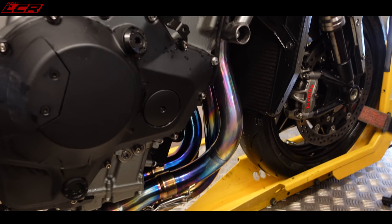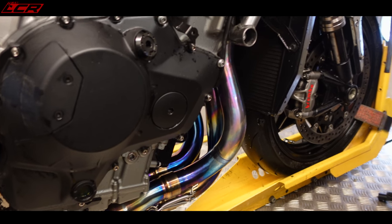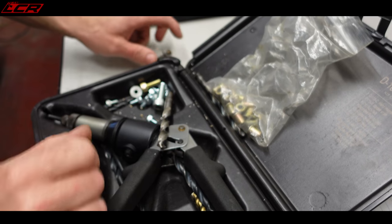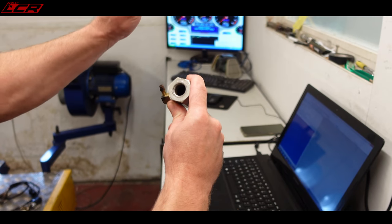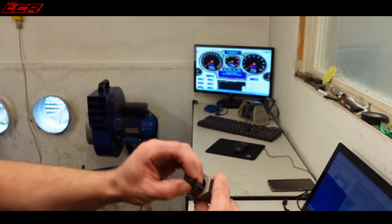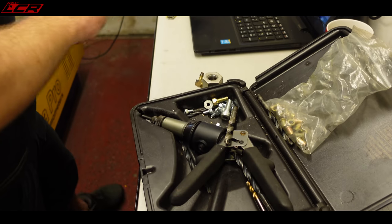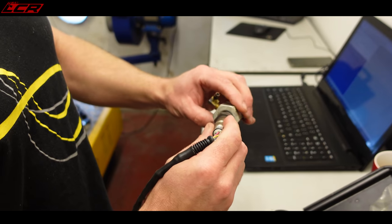So you make a 5mm threaded hole, and then you tap it. No, we've got a special boss installation kit. Use a rivet nut. It clamps into the pipe. This boss has got a hole in it. This bolt has got a tiny hole in it. The bolt goes through the boss. The lambda goes into the boss.